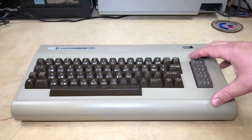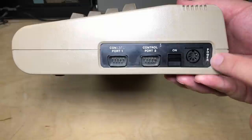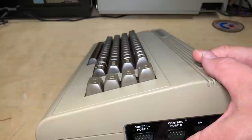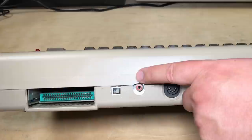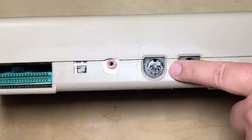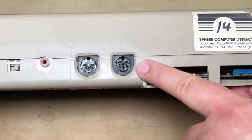Now moving on to Commodore 64 bread bins. This is one of the very early silver label Commodore 64s, so-called because the badge up here is silver, and many of them have the vertical power label over here on the right, while it's across the top on later ones. You'll see that later. And the back is very similar on these: expansion port, cartridge port, channel selector, RF output, and that's again that little rounded part here that we saw in those couple VIC-20s. AV output, these early C64s just had a 5-pin audio-visual port, while later ones went for an 8-pin for the improved S-video type output. Separated video, IEC port, cassette port, and user port.